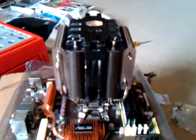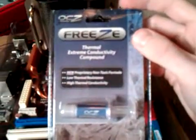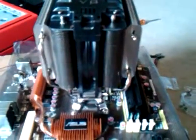Cooler Master includes its own thermal paste, but I decided not to use it. I used this — the OCZ Freeze — it's pretty good stuff that I used on the previous cooler. You don't need to smear it across the processor; just put a dot in the center and the force of the cooler pushing down will spread it out into a clean surface.